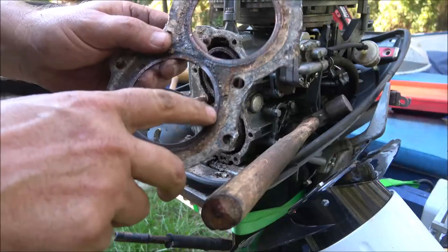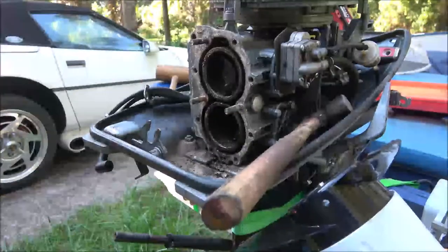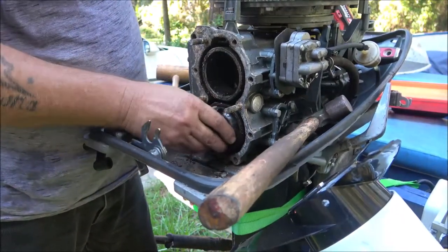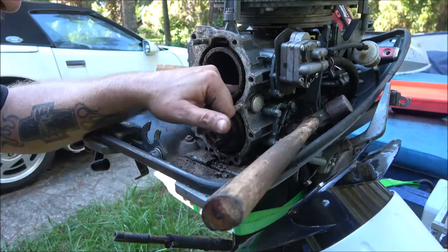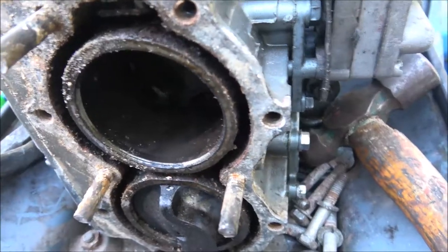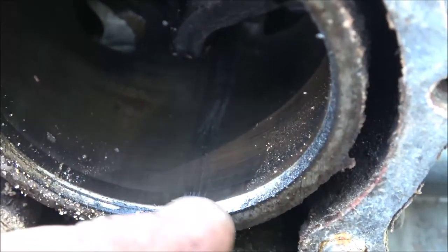There's the head - of course the gasket's off here. See what we can see. There's a lot of movement there. Never ran a compression test on it but I know the compression's low. And I do see some scoring down in here - I'll show you that. Right here - yep, there's some scoring in there.